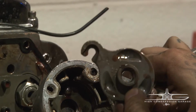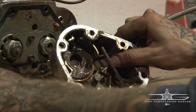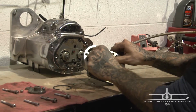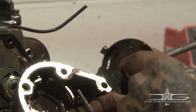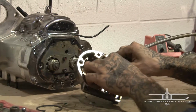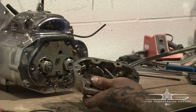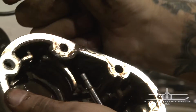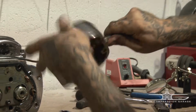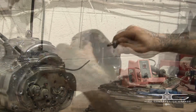You'll notice the 3 grooves in there for each one of your ball bearings when reinstalling. And your last piece right here is the bottom of your ball and ramp system. To unscrew this, you'll take a 9/16 wrench, crack it loose, and simply turn your outer case in a counterclockwise manner to unscrew it.